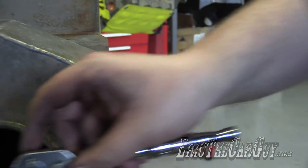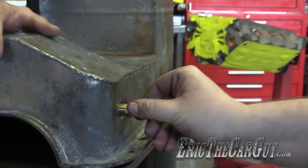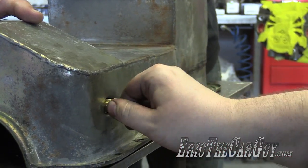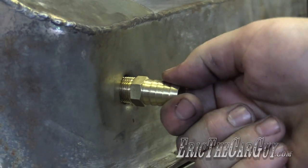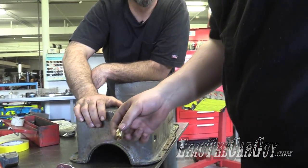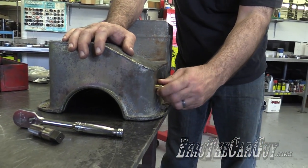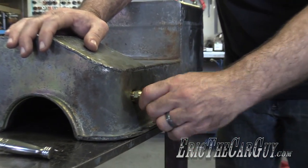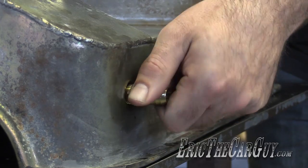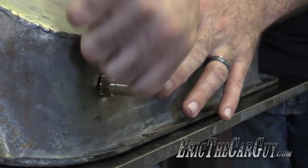I don't like that last turn there. It looked like it — just a test, this is only a test. A little bit more. A little bit more slamming with the hammer? No, tapping. Tell me what you think — it's your pan, it's your problem. It's brass, so I'd say run it in with sealer and it should seal up well. Do you want to run the tap in a little bit more? No, because I'm almost bottomed out. And it's brass, so it'll conform.